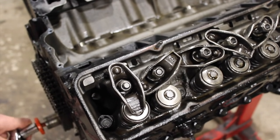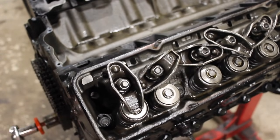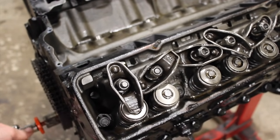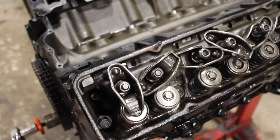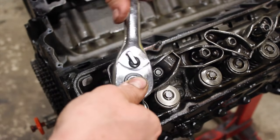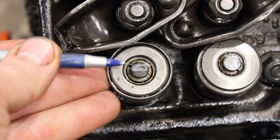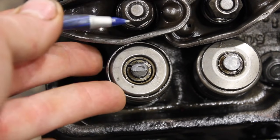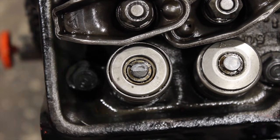So there's our rest setting — we're going to crank her over. I'm going to go around twice. Get her back to top dead center. Let's take this off and see what that pattern looks like. My stock pushrods are appearing to be too short. When you pattern it out and the pattern is closer to the rocker arm stud, see how that's closer? That's an indication that the pushrod's too short.